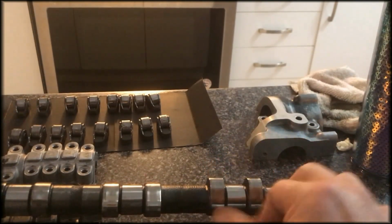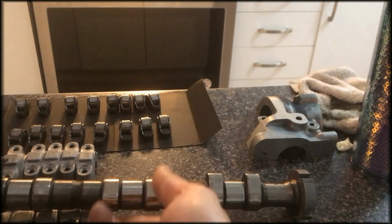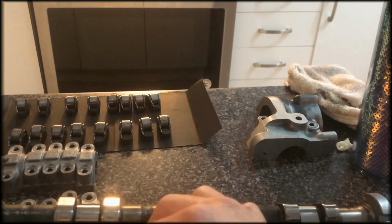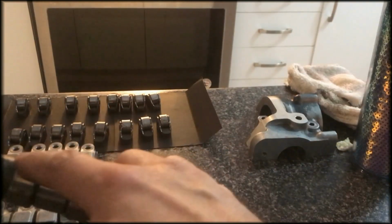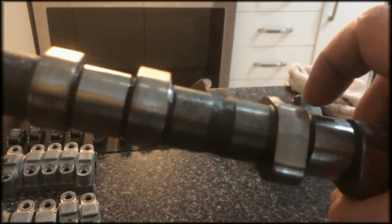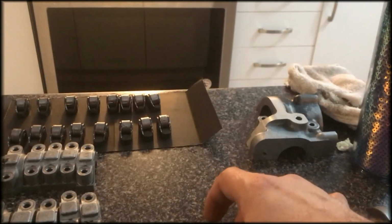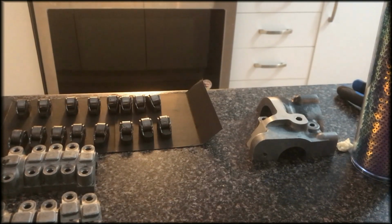I feel, see if there's any obvious flat spots, maybe, you know, a little bit. You see a scoring there. I don't know if you can see that. I can see it. There's a line coming through right this lobe. You can see it somewhat, the line. So I might look into that high friction area. I'm looking at the third lobe here. There's a score on that. There's definitely some strain there.